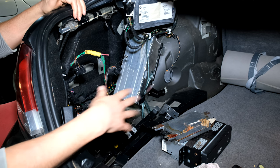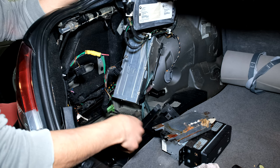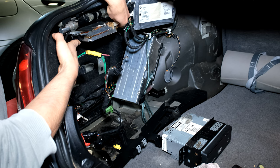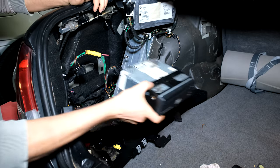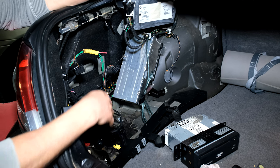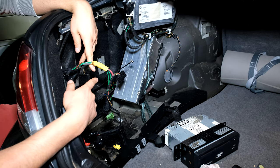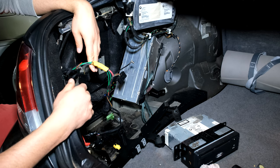I'm at the back of the car in the trunk area and I've removed the side panel. Some modules have been removed: the SVS module, which normally sits just underneath the boot hydraulic section — there's a hydraulic pump there — and then the nav sits over there. Now because the nav was going offline I removed it, because this is a fiber optic system connected as a ring, which means any device in the ring that is faulty will reset or make all devices go offline.